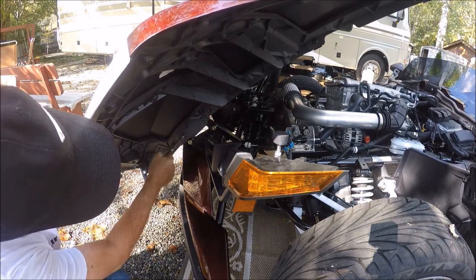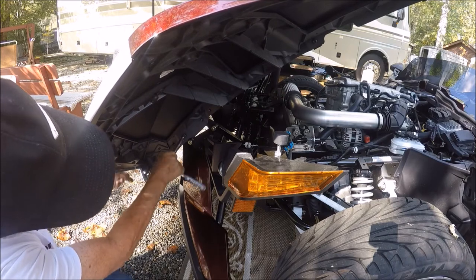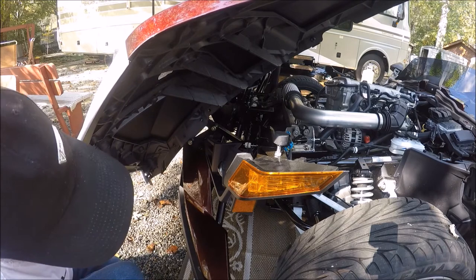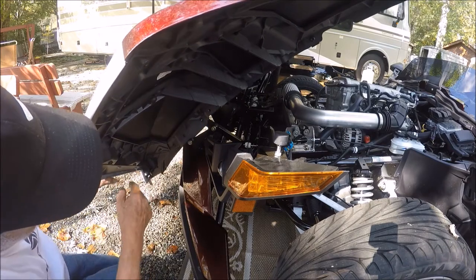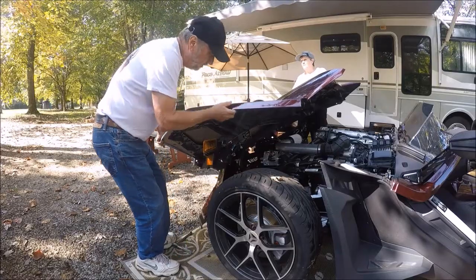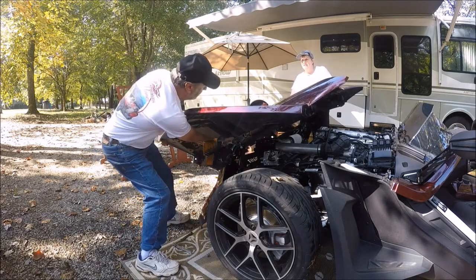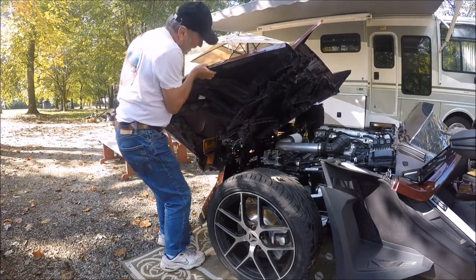Before I remove this one, I'm going to get my assistant to help hold the hood. Removing the support bolt — my assistant is on the other side holding the back of the hood up, taking the pressure off. Now it is only being held on the studs on both sides, so we're going to move the hood to our storage location. Pull on the hood to clear the nut — you may have to reach your arm under. Always remove it from the driver's side first.